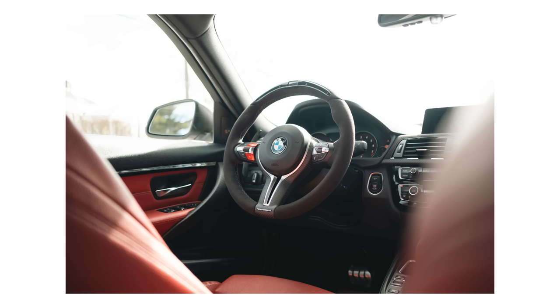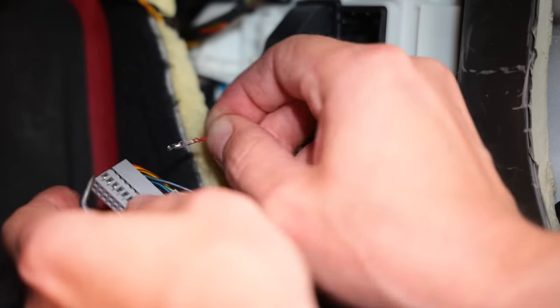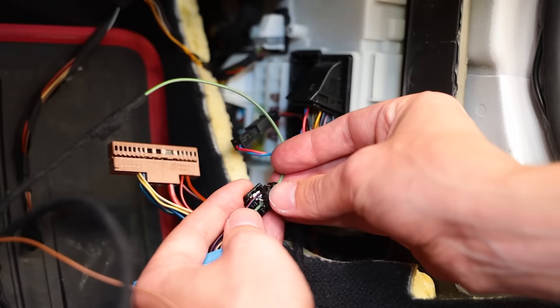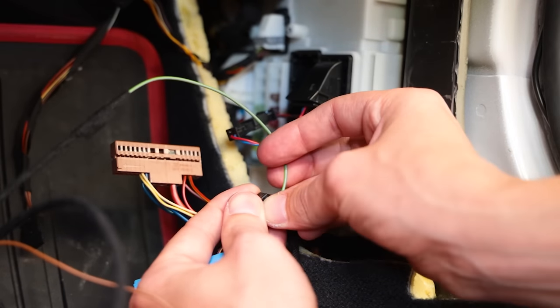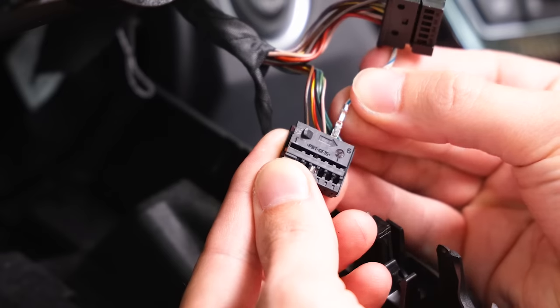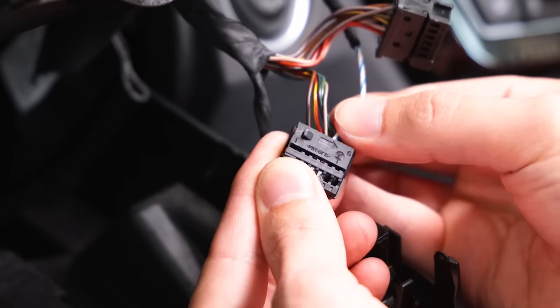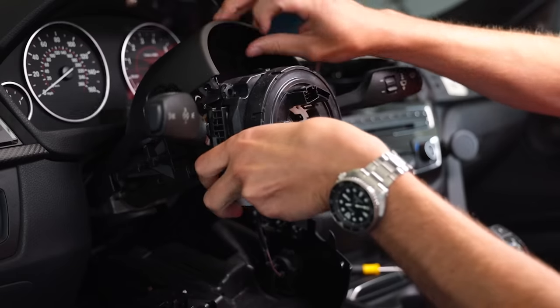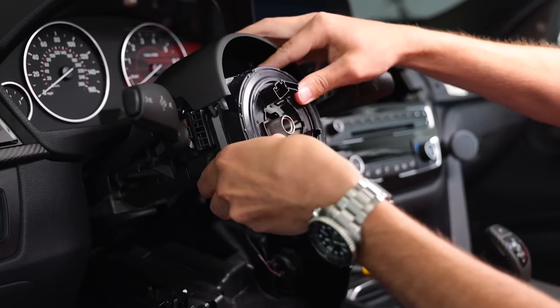It's cool to me not only that this wheel even exists, but that it's a genuine BMW part — I think it says something about BMW's understanding of their customer base. The installation was pretty tedious even though there's no coding required. You'll be repinning wires inside the steering column and inside the footwell module, which takes patience — if even one wire is installed incorrectly the whole thing won't work. I'd say this is an intermediate to advanced install, although if you follow my step-by-step instructions I think you'll have no problem doing it at home.